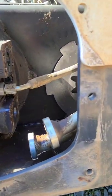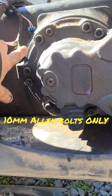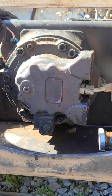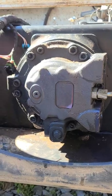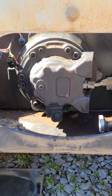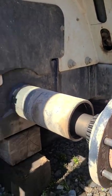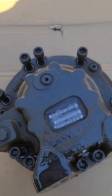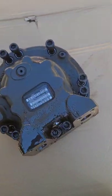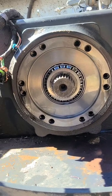I got the two hoses with the split flange pulled off the motor. I'm going to get this hose off and then pull all the big Allens out and take the hydraulic drive motor off. Once I get that off, I'll get to that carrier — there are six bolts on the inside that hold that on. Only the big bolts and the two little bolts hold the pump together, and there's the part I need to put seals in.